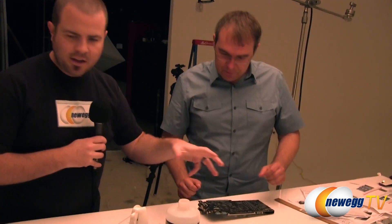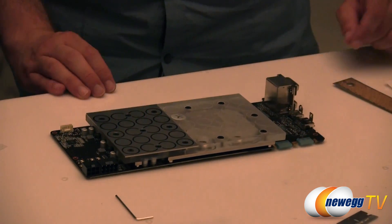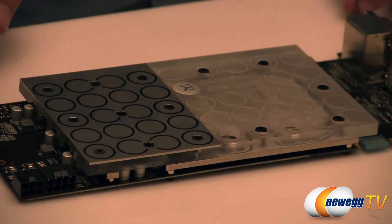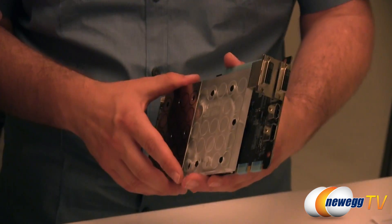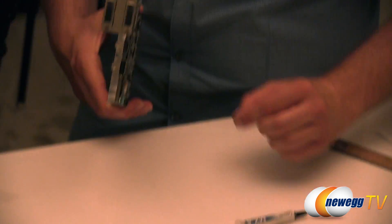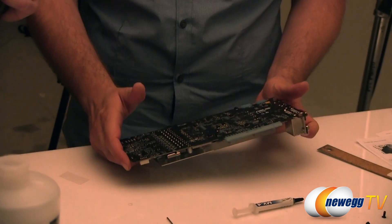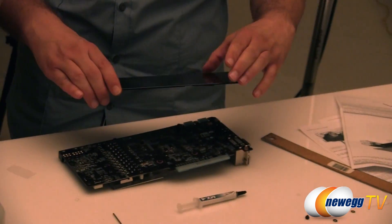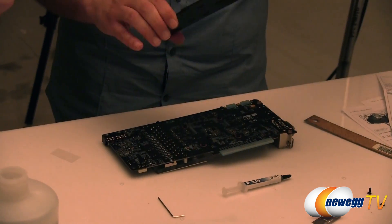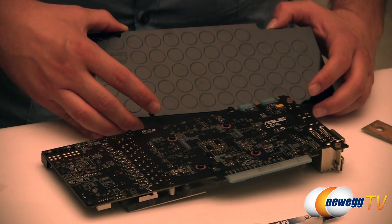Milos is working hard on the GTX 680 right here. The DirectCU II cooler has been removed — which is a very excellent cooler, but we're going with water cooling so it's going to be a bit better. The EK block is currently installed. The front water block, which is the main cooling component for the GTX 680, has been installed including MX4 thermal paste, and we're working on the back plate, also from EK — taking a very careful approach, analyzing all the matching fittings and making sure it all goes in properly. Since this build is for overclocking specifically, Milos has been very careful to make sure all the old thermal paste is removed to ensure good contact between all components.